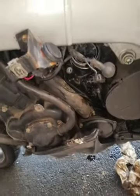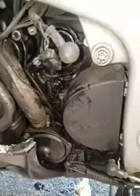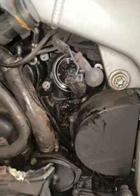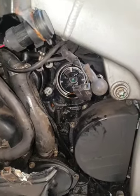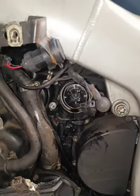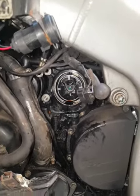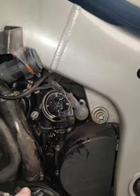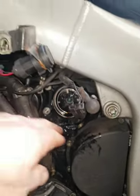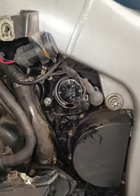It's pretty awkward, and I'm thinking I'm going to take this pipe off with the two clips, drain it into a bowl to save and reuse the antifreeze. It makes it a lot easier to get in here. Hopefully this time when I wiggle it in, it's not going to snap the O-ring, but there's no real way of telling if it has, unless either you get chunks of O-ring falling out afterwards or you get an oil leak. So I'm going to clean up the oil here now with some petrol and cloths underneath, and refit it.